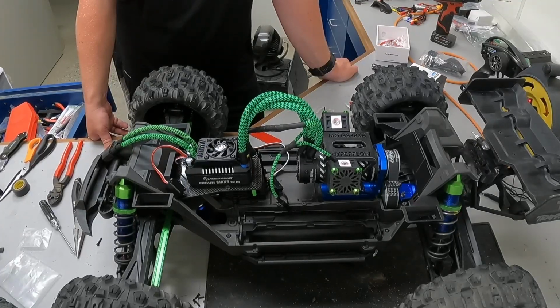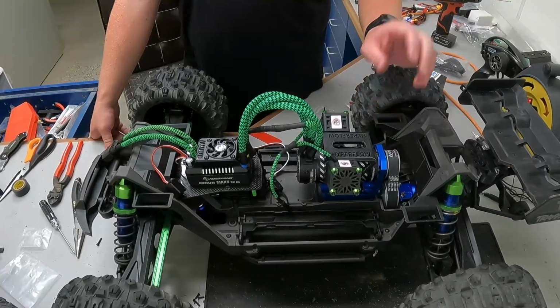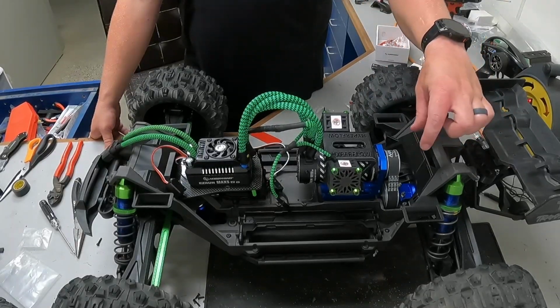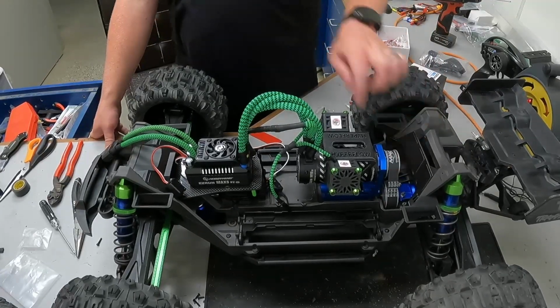and then really rip it. So one side note is with the belt drive, and especially with the belt drive cover, you do have to notch. There's the body support. There's a tab right in the middle that you're going to have to cut out to allow this to fit without rubbing.